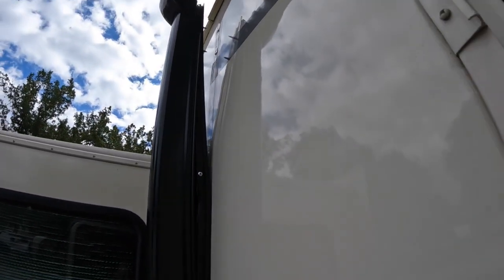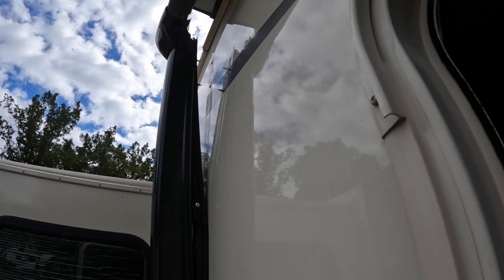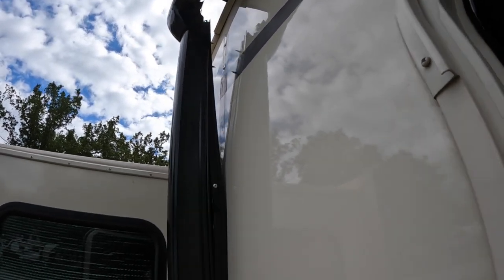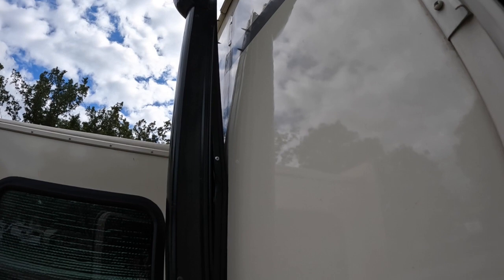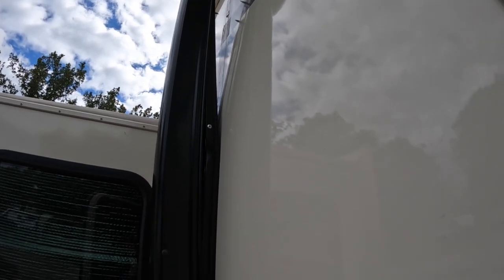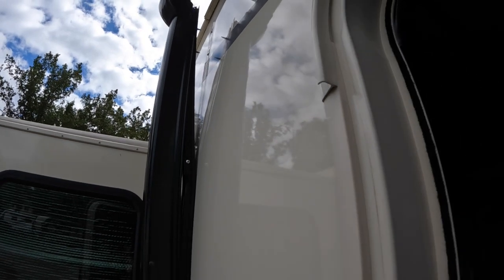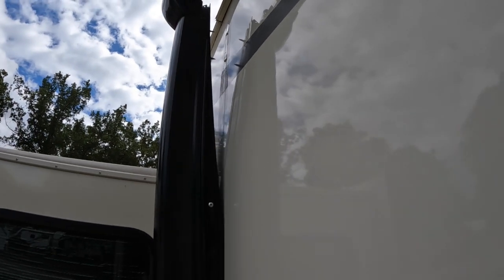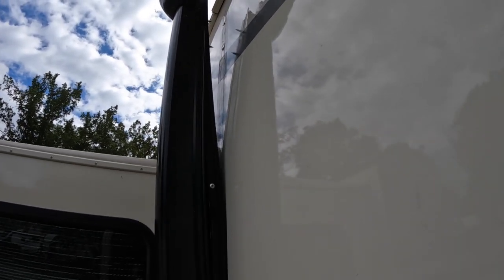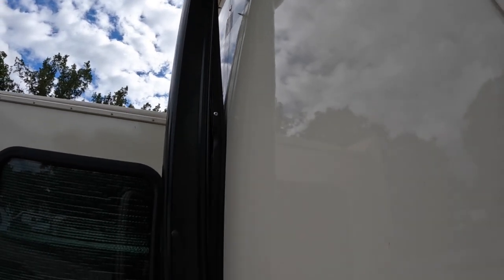Today's the first day of owning an RV and we got a welcome of new ownership. Last night it rained, it had water on the awning, and when this morning we were about to leave, we went ahead to make sure the awning was in — and it pulled out. So that's going to be in our how-to: fix an awning that comes away from the RV. The plan is either to use bigger lag screws, wider ones, or a bolt with a nut and a plate on the inside.